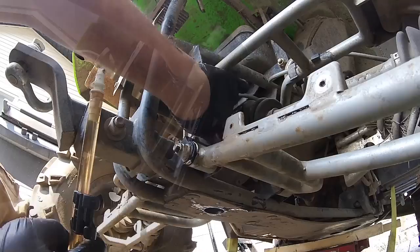Well, it's time to shut her down. What valuable lesson did we learn today? We got some serious front end differential issues — probably going to look at doing a rebuild this coming winter, possibly an axle swap as well, because that dirt plate or ring that prevents dirt from getting inside and wrecking the seal is hooped. Mostly water in the diff and very little oil is not a good sign. Besides that, the differential oil change is very easy. I apologize for the poor quality video because it's pretty small to get in there and I tried to use the best camera angles as I possibly could. Anyway, I hope you guys enjoyed the video — we're going to ride it like this until probably winter time and then bring it back inside, pull that differential out and rebuild it. If you guys have any questions or comments, post them below. Otherwise, thanks for watching.